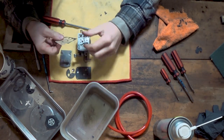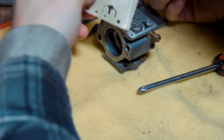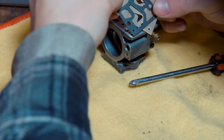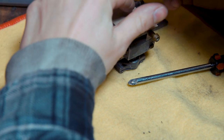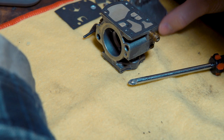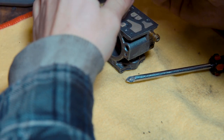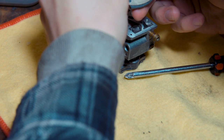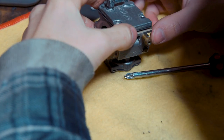Once that's in there, we can now add our final gaskets — make sure they line up and go the proper way around. This one sits in here. You can line these up by looking at which way this gasket goes, and then this Teflon one should line up — blocking two holes on the right hand side and then one hole on the left hand side. Place the gasket on top and then our covering plate. Have a look, make sure that goes around the right way — it's got a dome at the top, so that's fairly straightforward. Looks like there are some locating pins, so even easier. That looks like it's gone on nice and straight — fantastic.